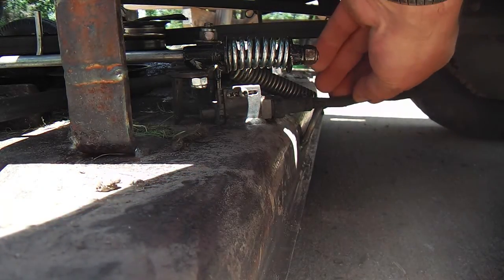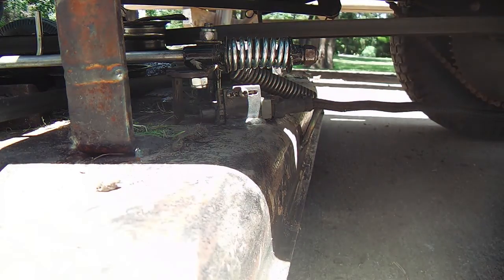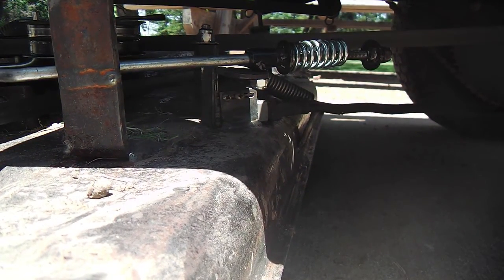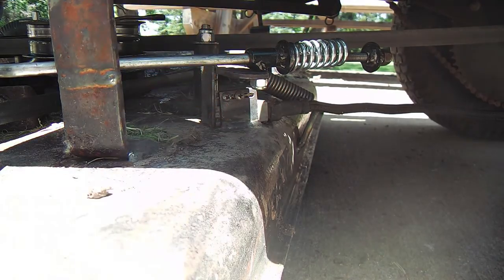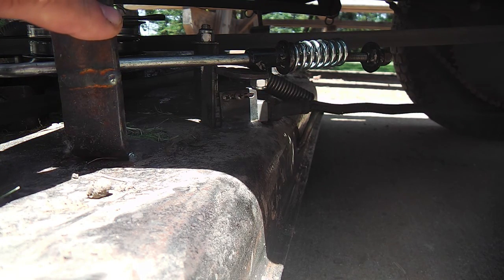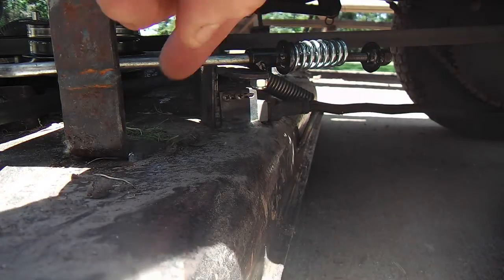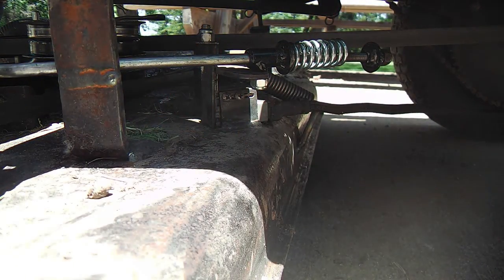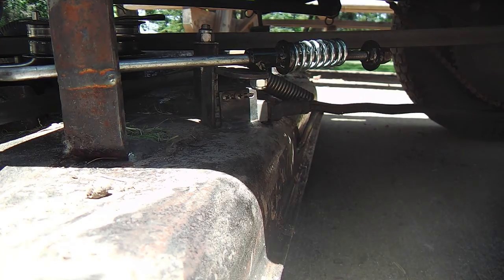Anyway, here's the lead to that button switch. You have to have the blade disengaged and the bumper running up against the button to close that or open that circuit to allow the starting of the motor. It's a safety feature so the blade doesn't turn, but I'm not actually using that band clamp as the manufacturer did as a safety mechanism. So I'll get some residual turning of the blade when I start this, which is not a problem for me. Maybe when the belt loosens up, there'll be slippage to the point where it doesn't do that.